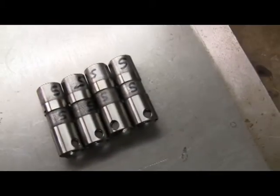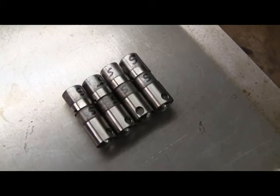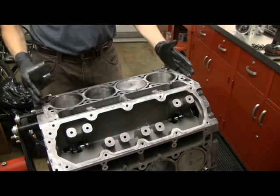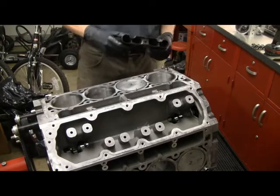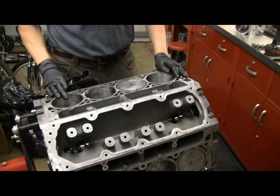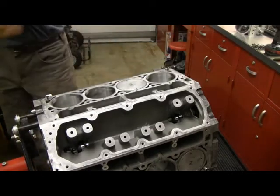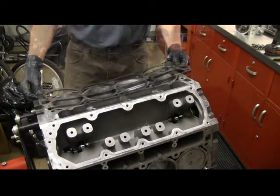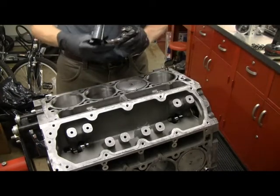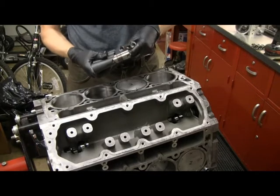I have everything cleaned up and I made four of these. I've labeled them with an 'S' for solid so I don't inadvertently get them mixed up with the real ones — that would not be good. To check pushrod length and piston-to-valve clearance, the first thing you have to do is mock up and put the head on the block as if you're going to assemble it. On an LS, you need to first put the lifters in the lifter bucket, because the head covers the lifters — unlike a gen-one small block. Put your solid lifters and lifter bucket into the engine just like you're assembling it.